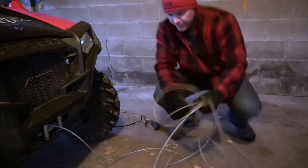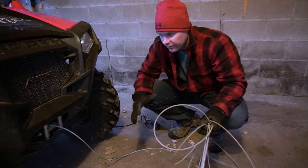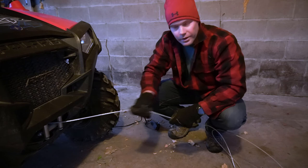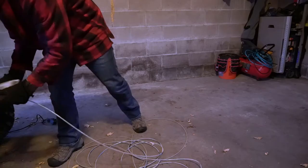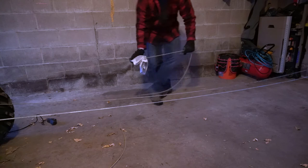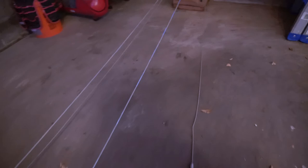So as you can see, I've got the winch cable out — I just pulled it out, it's a little bit of a mess. What I'm going to do is pull it straight out and during that time do a visual inspection and clean away all the debris I can find on here. There's little dirt spots, so I'm going to take a damp rag and run it along here and clean this all off. I've pulled the wire out so it's somewhat tight. One thing you want to make sure when dealing with the cable is not to kink it — those kinks are permanent, very hard to get out. It doesn't mean you can't use the winch cable, but it really degrades the integrity of it and makes the life of it shorter.